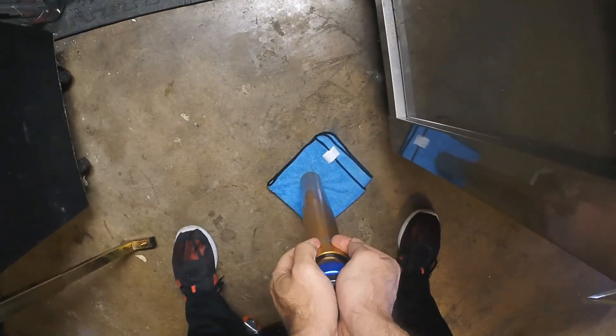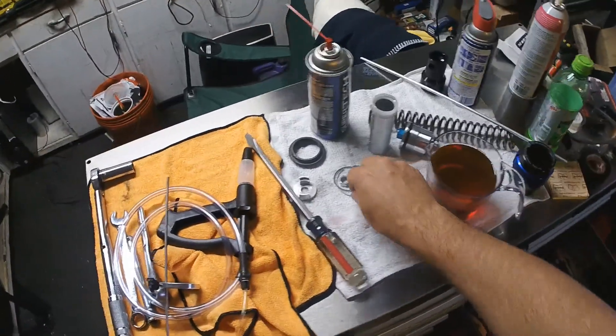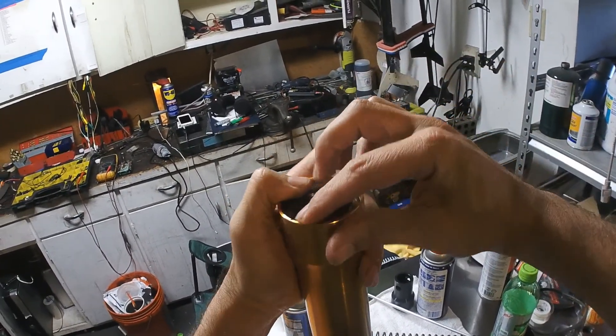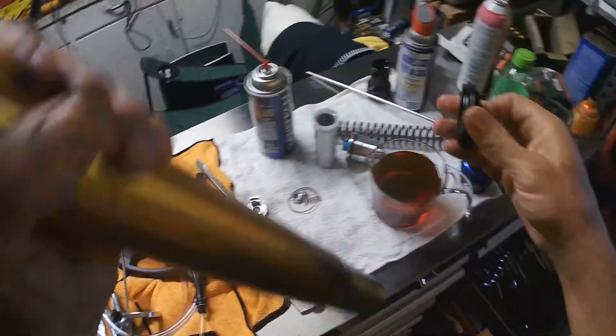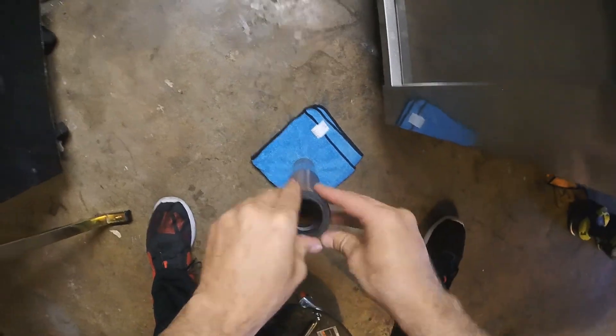So what I'm going to do is reinstall the washer — this is nice and lubed up with magic juice. And with the trusty old 43mm steel driver, we'll use firm but gentle pressure. There we go, simple as that. Then in goes the clip. Simple as that. Now we can put in the reused dust seal — same thing again, firm but gentle pressure.